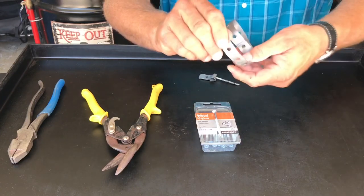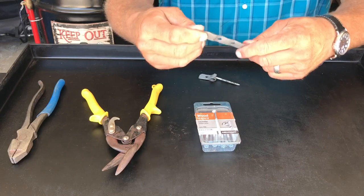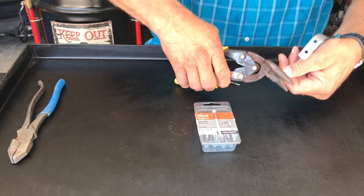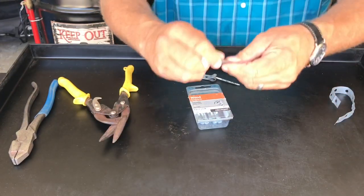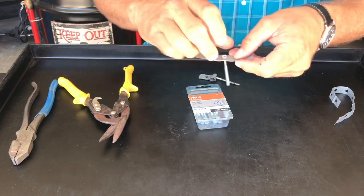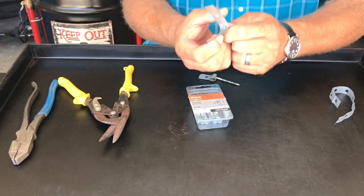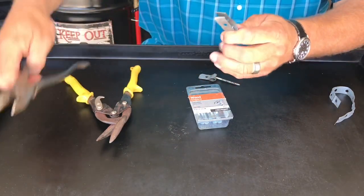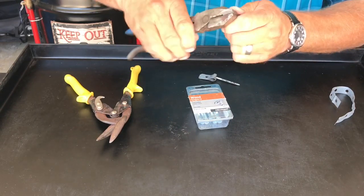Here's all there is to it. I'm going to cut the muffler strapping and retain three holes — cut that as square as we can. Grab the screw that ran away. We're going to put the screw in the center hole like that, and bring these two ends up together.